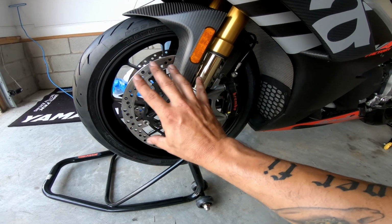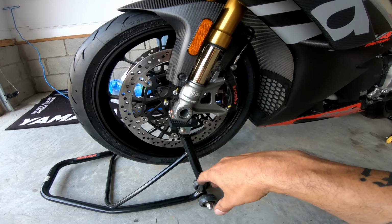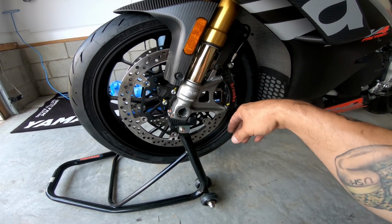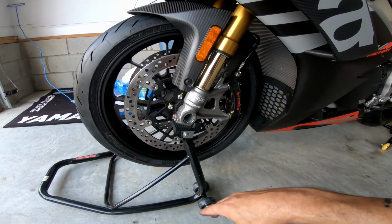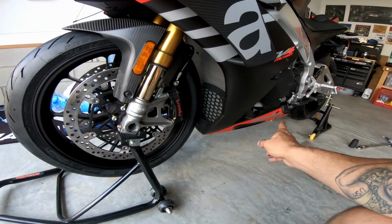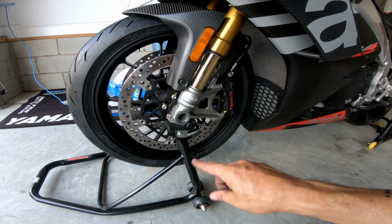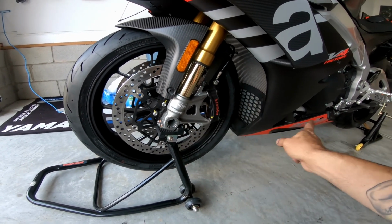So I'm gonna go ahead and tighten all this down, check the torque, and then I'm gonna pump the brake up. I already put this side on, but I haven't tightened it yet, so I need to make sure that it seats itself. And once it seats itself after it's pumped up, then I'm going to go ahead and torque it down and then give it a little spin, make sure everything's good. The back is good. Everything's tightened down. At the end of the video, I'll also put in the description the torque specs for the calipers, the pinch bolts, and the axle nut.